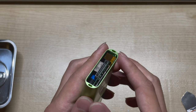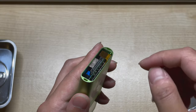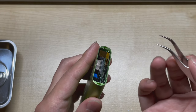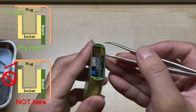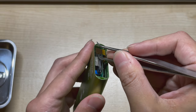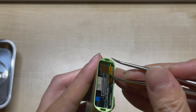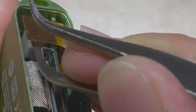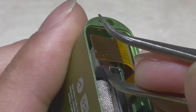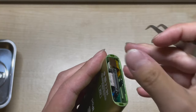Now here's the tricky part. The click wheel ribbon is connected to a plug that's plugged into the main board and the common problem people have is accidentally prying the ribbon off the plug and tearing it, which permanently damages it. So in order to remove it we need to get something thin like either a pry tool or tweezers and make sure we insert it between the plug and the socket and not between the ribbon and the plug. And we just gently pry — we don't need to pry all the way upwards but gently loosen it from either side until the plug comes out.